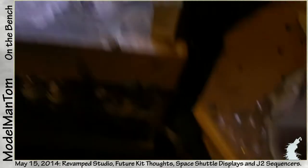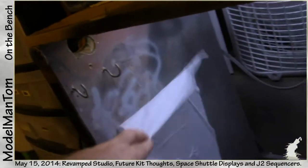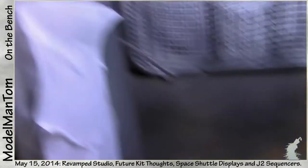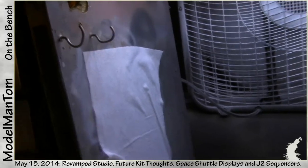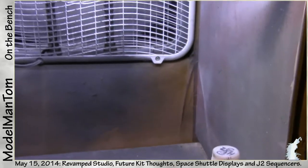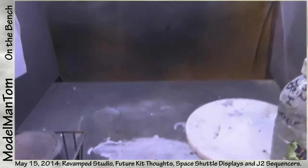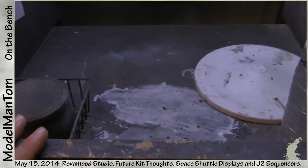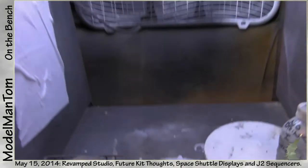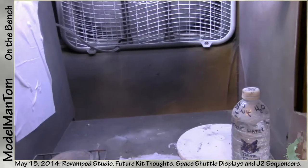Over here at the paint booth, one serious thing I need to do is take the orbital sander and do these inside walls. This is actually an anti-static piece of fabric — I was hoping it can catch some dust and debris while I'm painting. The wall here is really rough and pebbly from all the paint spray, and there are dust bunnies just sitting on the wall right there. I've determined that one of my major problems when I'm painting is getting dust in there, because of a situation like this. Every time before I paint I have to totally clean this out.